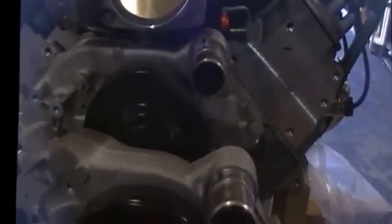The biggest difference is the offset. You can see that the Camaro pulley is offset further away from the cylinder heads. You're basically just going to take the four bolts off and put this pump on. This harmonic balancer you're going to take off and install our supplied balancer. That's true for right now — we have some products in the works that might allow you to run any balancer you want, but for now we're running the truck F-body balancer.